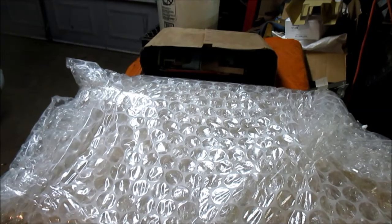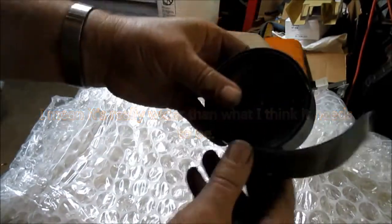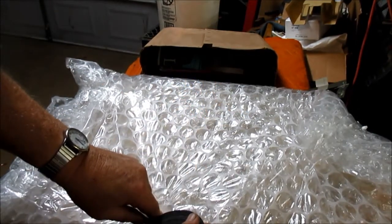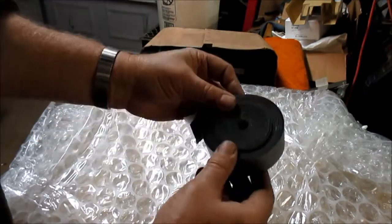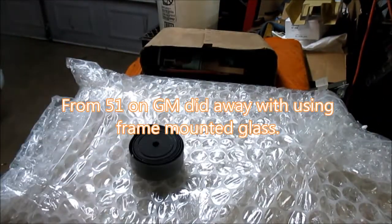It seems really thick, so I think I'm going to have to cut it to fit. So here's the window setting tape here. And it goes actually in the channel of the frame. And I'll cover that deeply when I go to do it. And then it helps hold the glass in the frame. I guess it keeps the glass from rattling around in the frame. And then the frame is then installed into the door. So anyway,